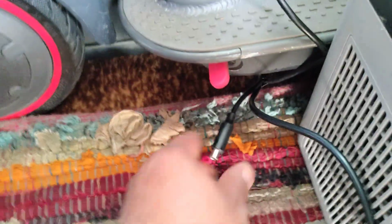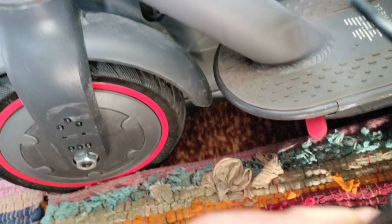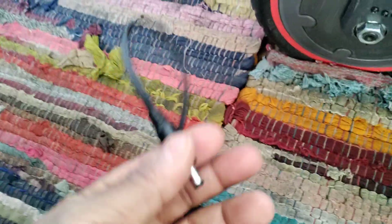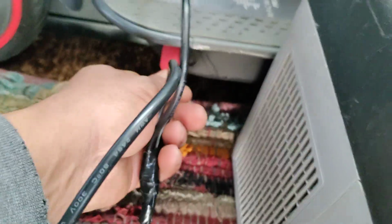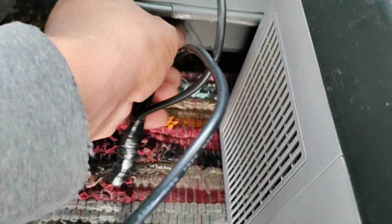The other power pack, the power brick, just went dead. So what I did was I made two different tips, because it's not the same kind of charging port. This is the original, and I used what was left of the Max Oak. I cut this whole wire off from the brick and tapped into this charger, and so it works perfectly.